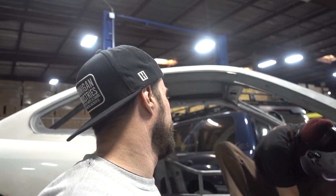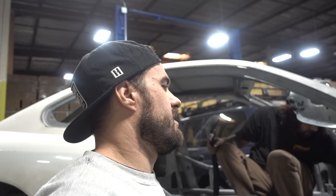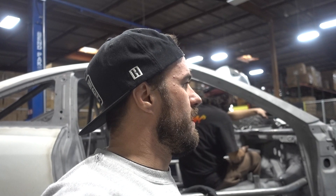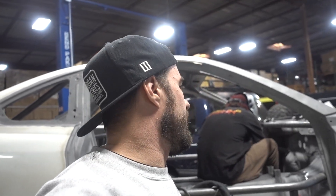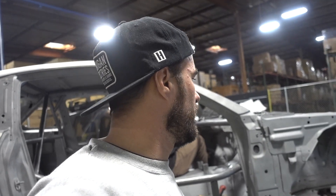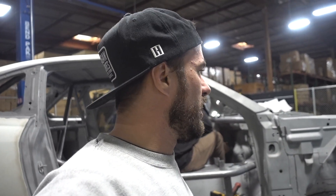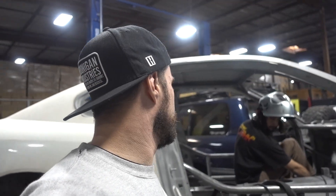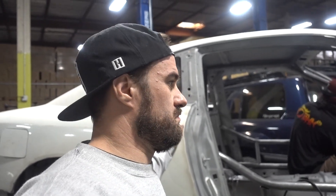We'll keep plugging away after that. Got to order some stuff — the RB30 block with the RB26 head will be here on Tuesday. The difference from a 25 or 26 to a 30 block is about an inch difference on the deck height, so we have to take that into consideration. We could have potentially just taken what we had out of the S14 and kind of bombed everything out, but that won't be the case. Throughout next week we've got to go through and finish prepping the rest of the chassis, do all the spot welding, cut certain areas off — the quarter panels have to come off, cut the tubs out — and just continue on from there as more parts start coming in.